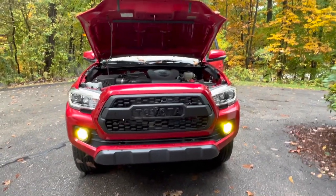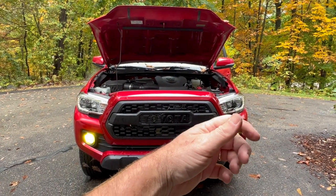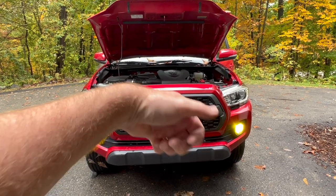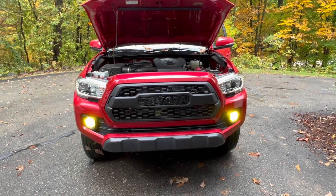Just to remind everybody: the clip is pointed down. You pull the wire harness off straight down. You twist it from vertical down to horizontal — 90 degrees — to loosen, and that's counterclockwise. You pull it straight out, put it back in straight in, and then right down. That's all it is, just reaching from the top.